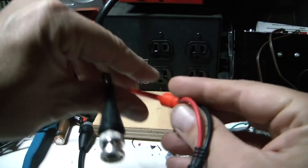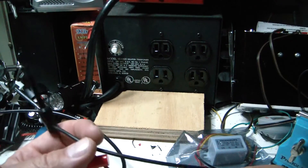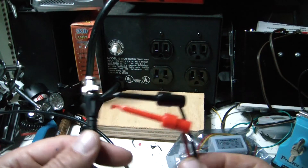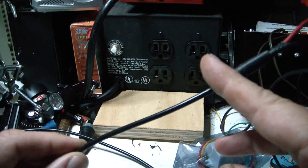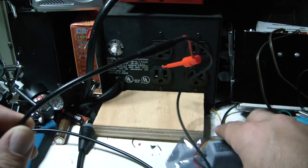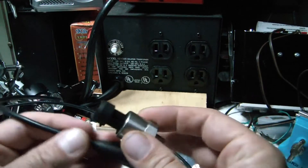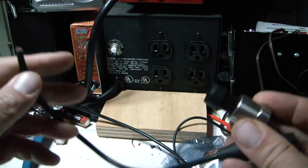The other piece — because I wanted this to go to my oscilloscope — is a BNC cable that goes to a hook test clip. I got one of these for about five or six dollars; you can get two of them for probably less than $10 on eBay. What we're going to do is cut off one end, leaving it fairly long — about a foot and a half to two feet — to move the sensor around. This is what we'll attach to the power supply voltage and then connect to the cable that came with the sensor. That cable plugs in and has three wires: power, ground, and the signal wire.